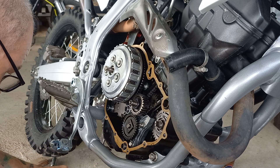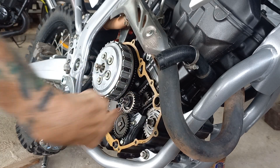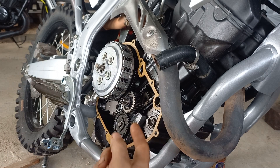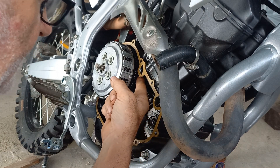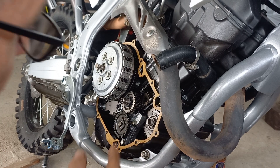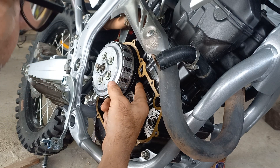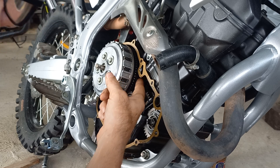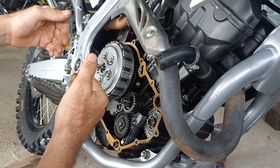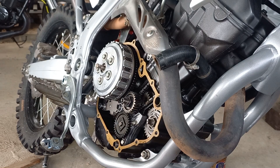The next thing I was thinking — if you watched all my old videos this is where it pays off — you would have seen that the bearing in the back blew out the end of the gearbox and blew the casing up. I had to get the casing welded up. So what I was thinking is, if they welded the back of that gearbox but brought the bearing too far this way, it means the whole clutch would have been too far this way, which means the arm would come around too far. That all kind of makes sense.